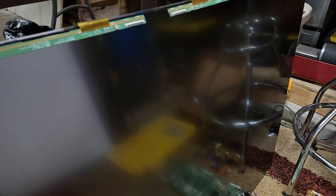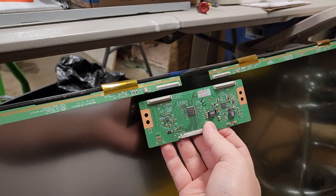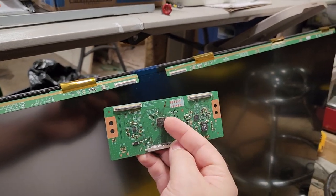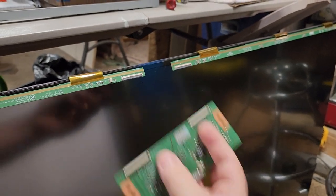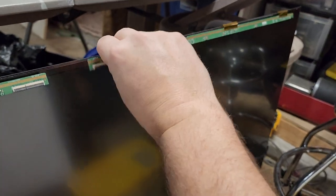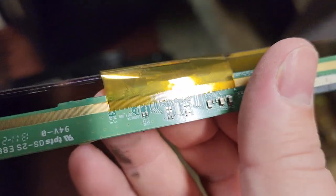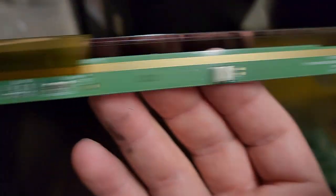This is the part that often breaks if there's physical abuse or it gets scratched up. You see these two guys up here at the top — these zone off your image. The little board I showed you earlier sits right here on the back. Your main video comes in, goes through this little processing chip, and it divides the video between left and right. Then it goes down to its respective line, which is one section of the display. On the bottom of the TV there are really paper-thin ribbon cables — tiny and absolutely complex.